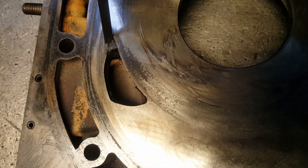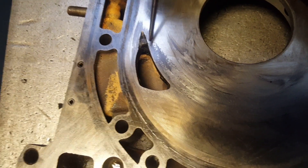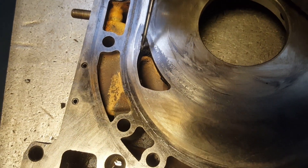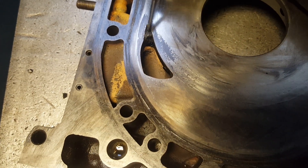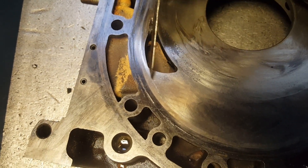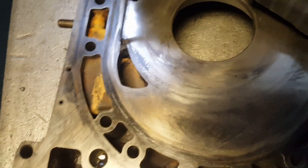We're going to have to remove this and I'll show you in one of my other videos. We're going to clean it up and polish it so the carbon can stay away from this little pocket or corner in here. I'm going to remove this one right now, and once I'm done with all the measurements I'll go back and either port it out or polish it in here to avoid more carbon build-up.